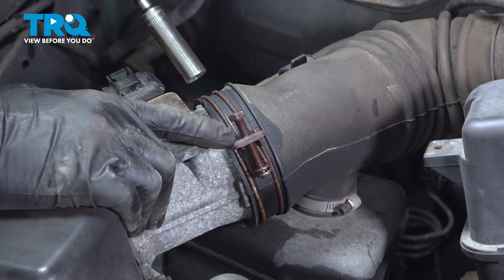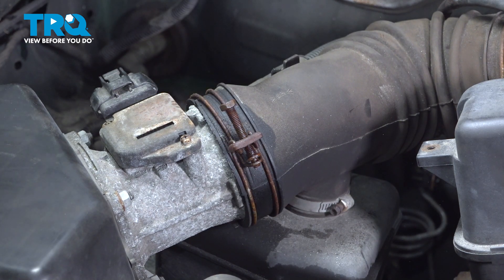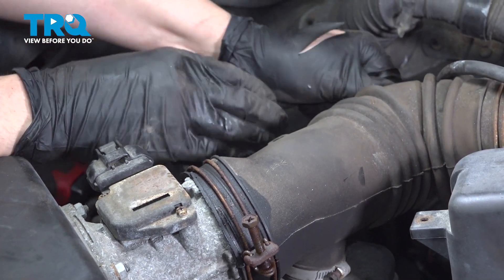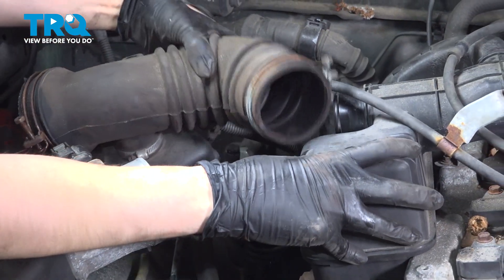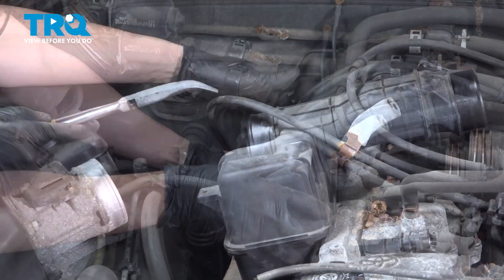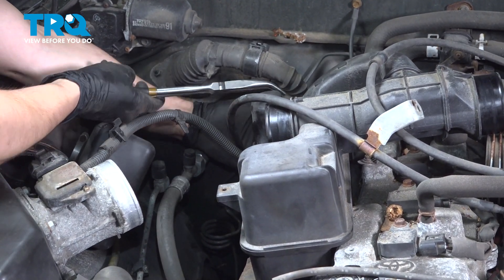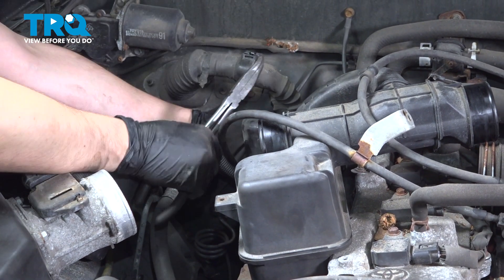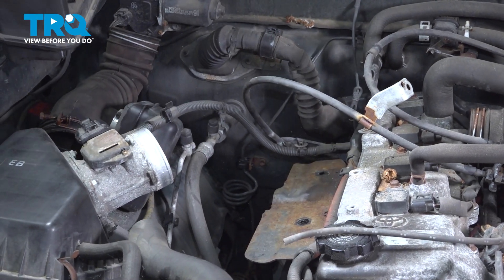In order to make a little bit of extra space, you can take this clamp off so you can pull the whole thing off at once. You may not have to, but I prefer to do this. Loosen it up, get this wire popped off of here. There's another similar retainer in the back here, then we can remove this. Back here, this wire clips on with one of these clips and it's easiest if you pinch it and push it through. It's pretty difficult to see, but you can also use a trim tool and kind of pry it out of the way.